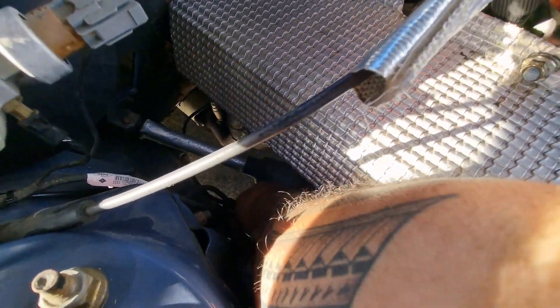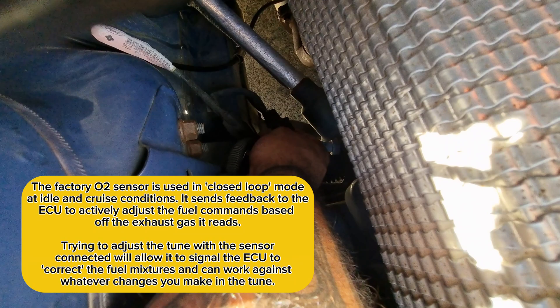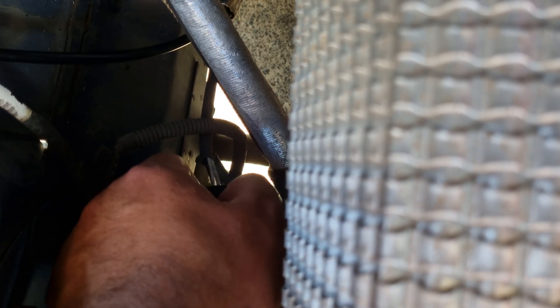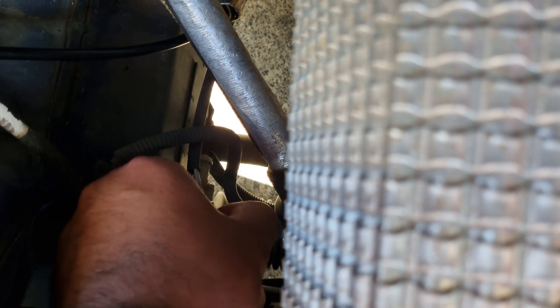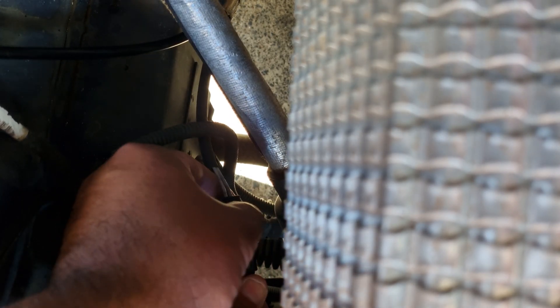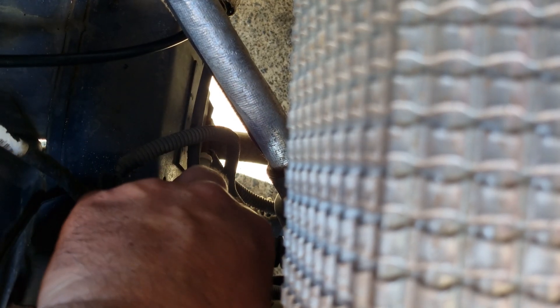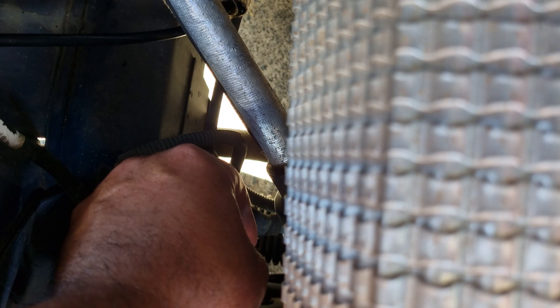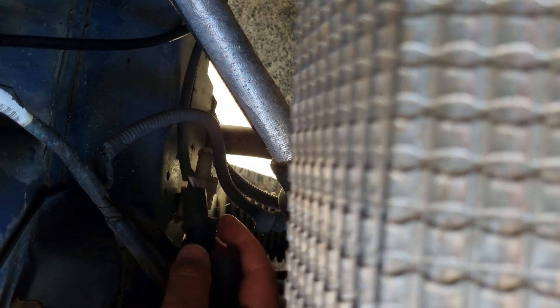What we're also going to do is unplug the O2 sensor wiring, which is just down here — a little plug down there. Just go down there and try not to get our hands cooked on the headers. It's a little disturbing because they've been sitting together for a while. Very stubborn. There we go — we'll just unplug that for the time being.